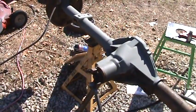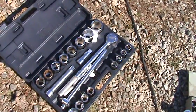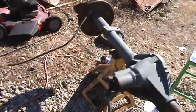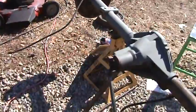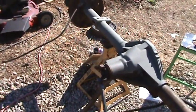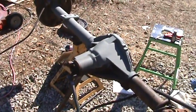I'm not gonna fret it. I brought out my one-inch stuff and we're fixing to put a cheater on it and go ahead and bear down on it a little bit more. It's important you get them tight because your backlash and everything are set on a preload in the bearing.